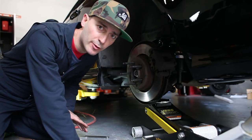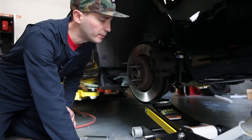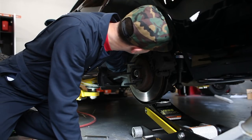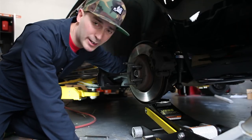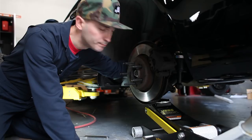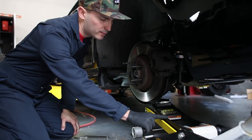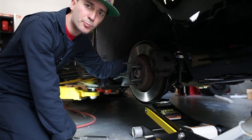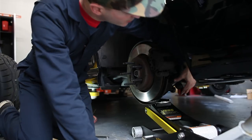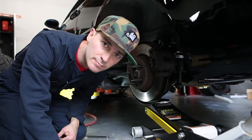I'm taking a guess on the ride height right now. It'll only be after I put the wheels and tires on the car and lower it that we really see what we've got, because this adjuster is adding almost an inch by itself — so it might be too much. Now what I'm going to do is jack it about 10 millimeters more to set preload on the spring and adjust so that these two holes line up.